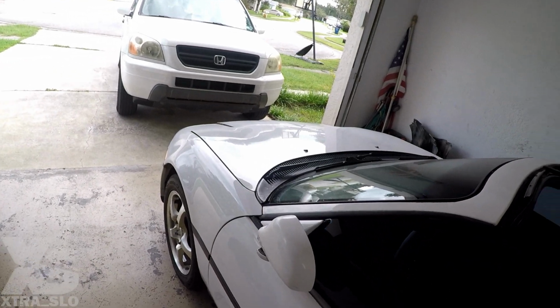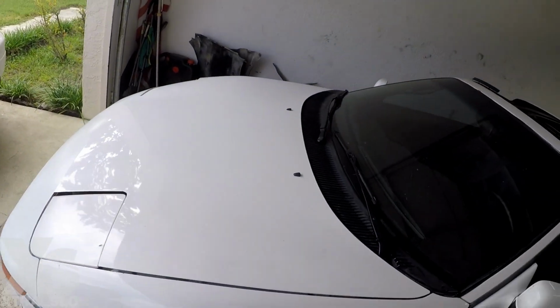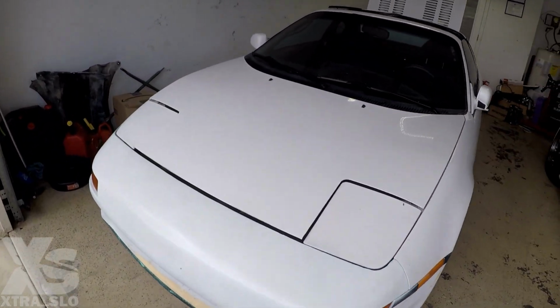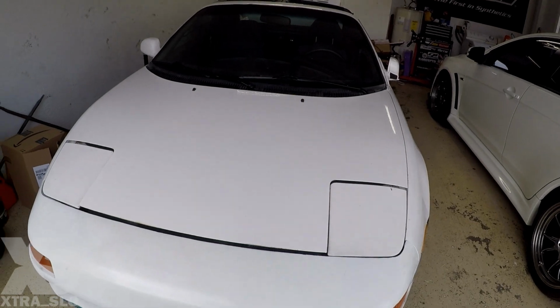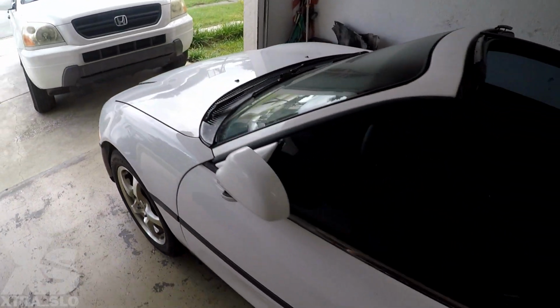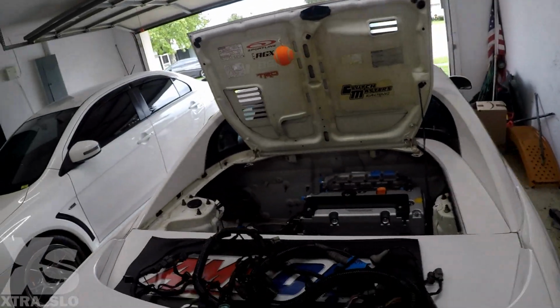The reason I'm doing that, guys, is that it's way less complicated if you have a fuel cell that has the tanks inside, the surge tanks, all that good stuff. As you know, surge tanks are really, really good for fuel delivery and demand. It never runs out of fuel because you always have that extra tank holding some fuel in it. All right, so super pumped up about getting that whole setup. We've got to wait for it. 8 weeks on back order minimum, it says, until I get that actual fuel cell. That is pretty far ahead.